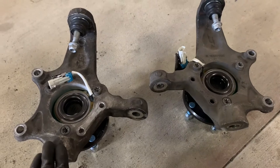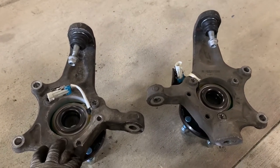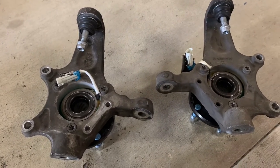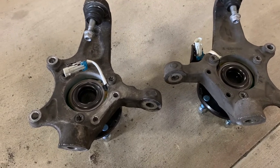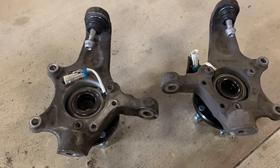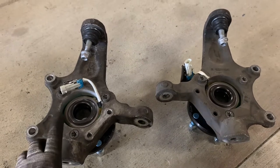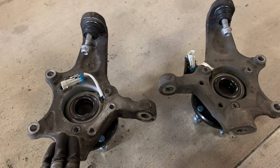The other thing that could be an issue is that you can crack an upright — I've had it happen to me one time. It happened as a result of wheel-to-wheel contact with another car in a pretty substantial hit, but it actually cracked my upright and caused a little bit of wobble in the hub. It was very noticeable and it was the end of my race. So if you want something that's a little bit more reliable, you can go with the C6 version of this.